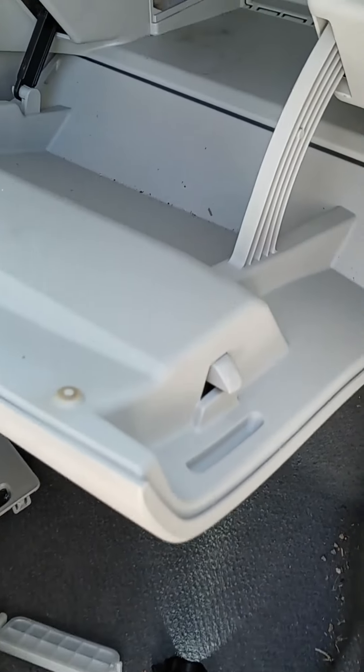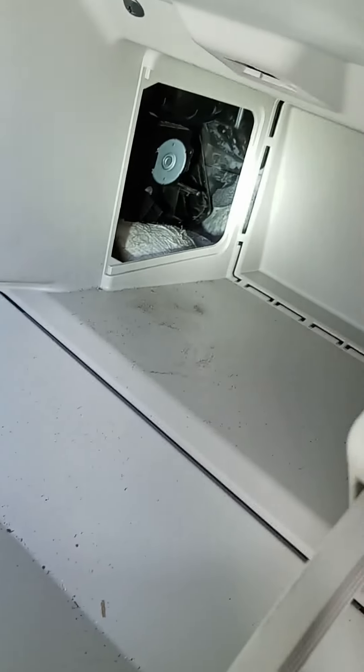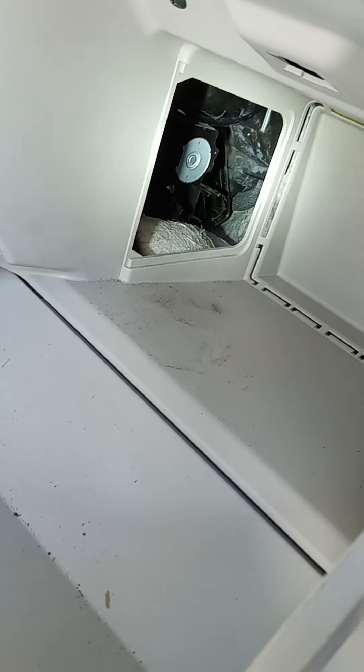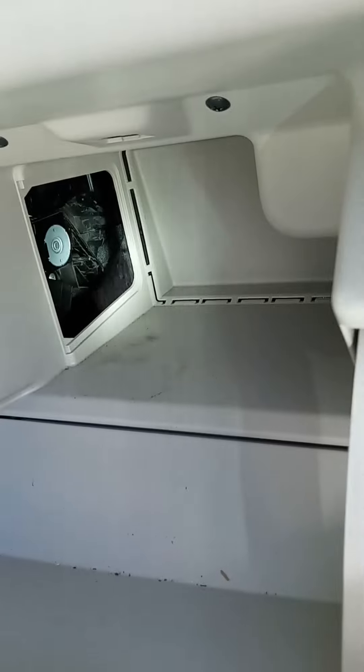When I looked back at the glove compartment, I think I could snake the new filter through this hole, but I'm going to follow the conventional wisdom of other people on the internet and YouTube — I'm going to take off this bottom plate here. It just snaps right in and there's actually a hole that I can grab here, and it's only just pop tabs. So pop, pop, and not much to it. I think I'll have a better chance of snaking this filter up into that.